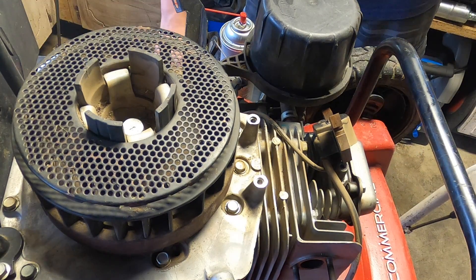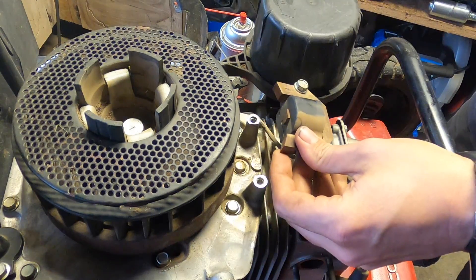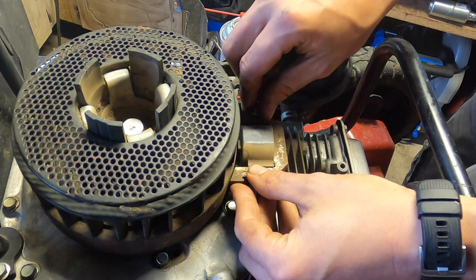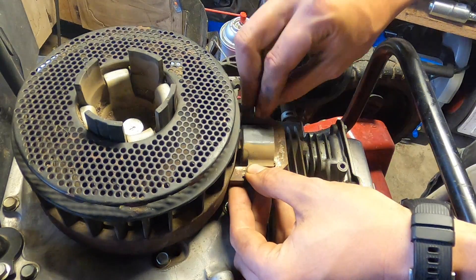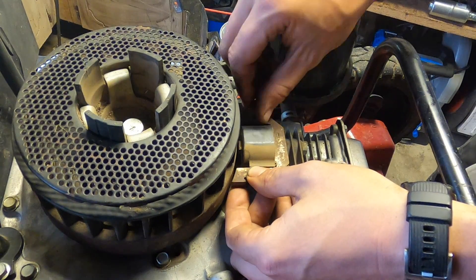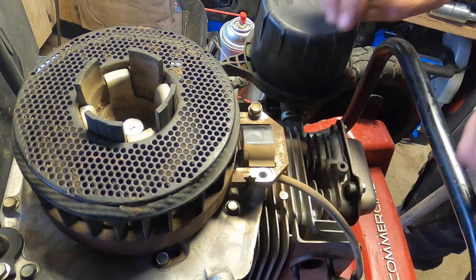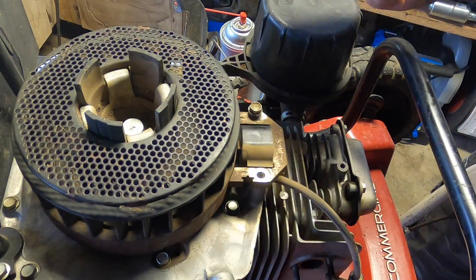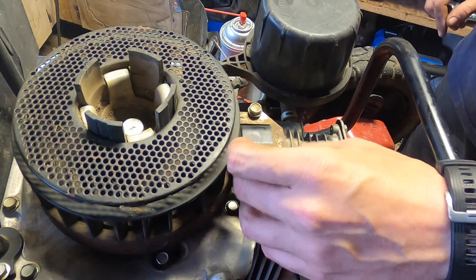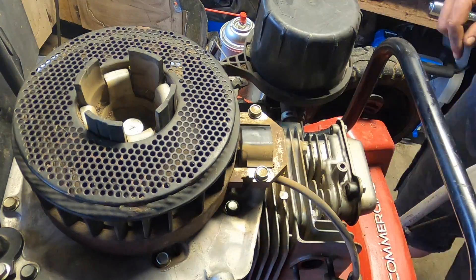The very first thing is we need to get our coil. The orientation of the coil is important. If you're replacing your coil, you need to make sure you're putting it on the correct way. The easiest way is to look at it when you're taking it off. Usually there's some type of marking — for instance, this one has a little notch. It's just different on either side, so you can easily tell. Putting it in wrong will result in a bad time. You can have kickback, it won't run very well, it might not even start. If it does start and run, it's definitely not going to run well. So make sure you do that.